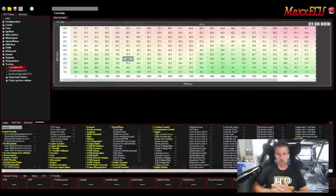We've also coupled this up with the Max PDM20 power distribution module. The two units talk to each other via CAN, and you configure everything in the power distribution module straight from the mTune software — so for all intents and purposes it's no different than setting up a conventional auxiliary output on the ECU. Worth mentioning that the PDM20 is really locked down to the Max brand; it's designed to work solely with the Max system. We'll jump across to my laptop screen. I'll work through the software and start the vehicle towards the end to show a couple of features.